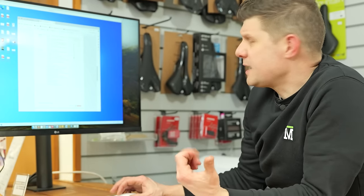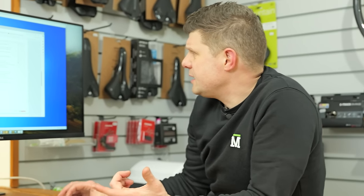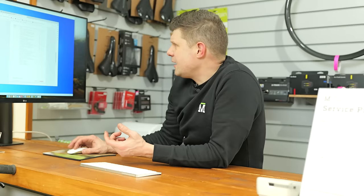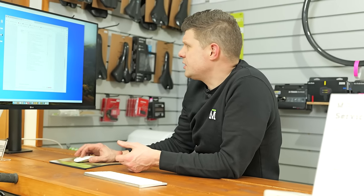We've checked the battery when it was out, so make sure you remove the battery and check that it switches on and off at the battery. Check the housing that we showed you, check all the cables coming out of it, and carry out a test on the charging function. We had this charging overnight, so we know that it charges absolutely fine. Clear the error memory and check the software is up to date, all done.